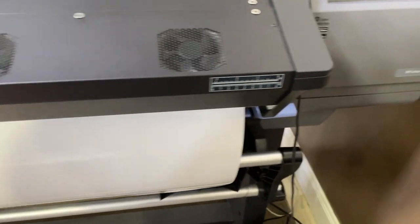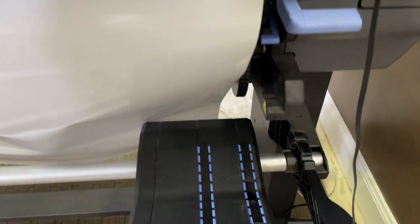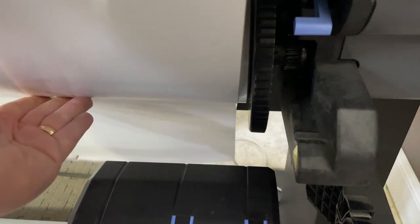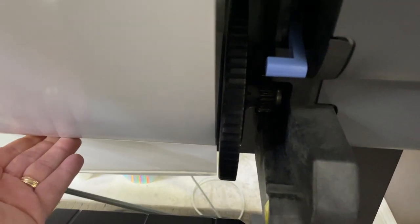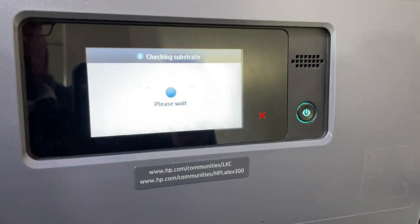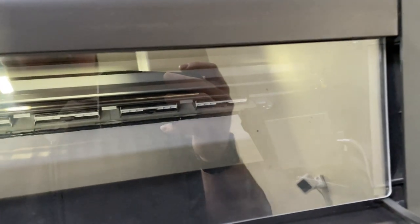Click retry and it's going to feed a bunch of the media out. What I like to do is get that behind the tray — you can see that's not lined up. So if you lift up the lever, line it up, and then pull the lever down, that should fix it. Usually I pull the lever with one hand and hold it with the other — we'll see if we succeeded.